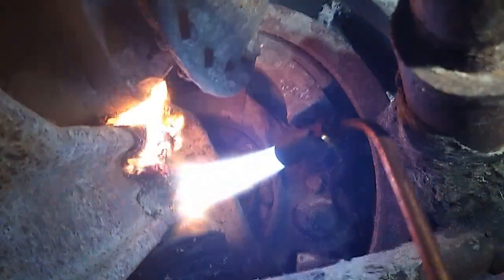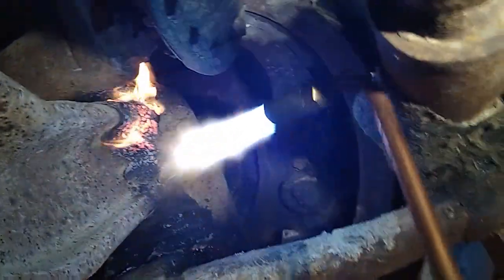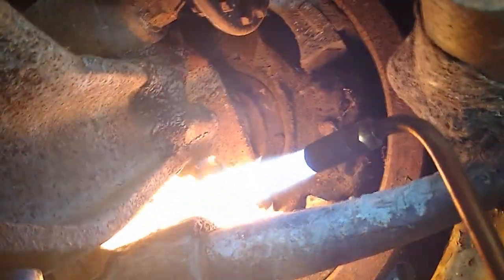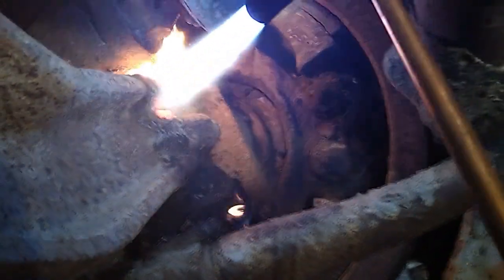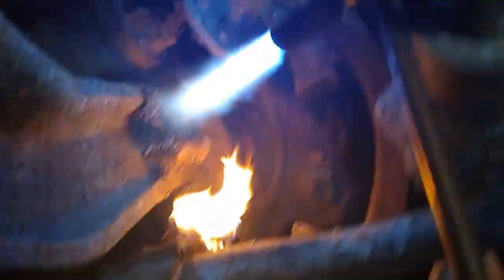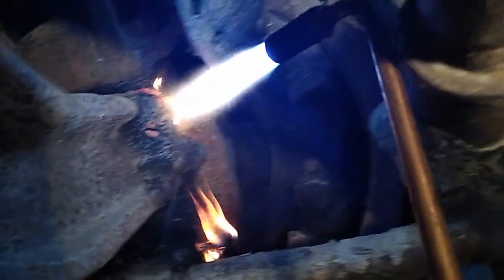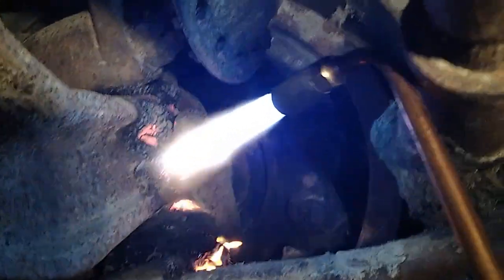So once the kingpin inside of the axle here is free of the weight of the bus, that grease will ooze down from the top into it and up from the bottom into it and around the pivot part. That should be warm enough now, so let's see how that goes. Little pieces of crud burning. Don't panic. It'll burn itself out.